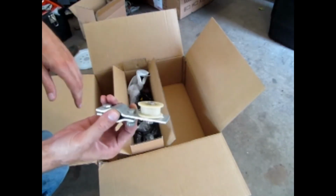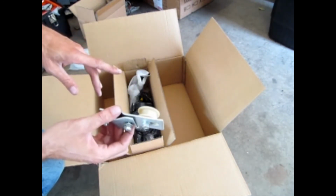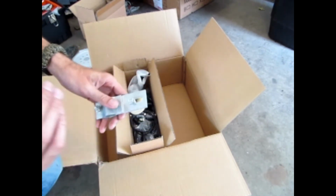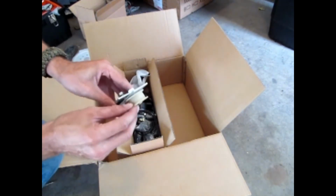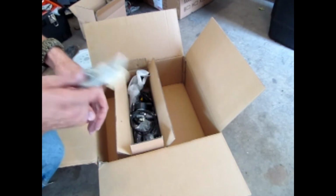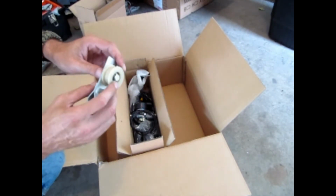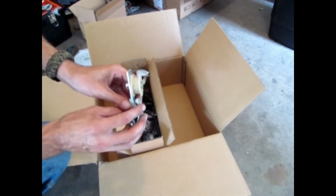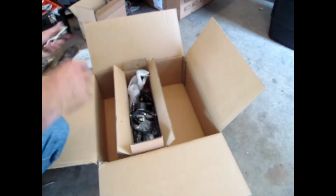You want to use this. People say, well, why do you have to use one? When you have the chain tight, what's going to happen is you're going to drop the clutch, you're going to pop it, and your chain will want to tighten up really hard. After a while, you'll see this thing actually moving. It took us a while to actually learn how to do this without these things falling off, rattling apart. The wheels would fall off. They would derail your thing, because when you tighten it, it would kick it down or kick it to the side, and we'll show you how to do that.